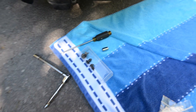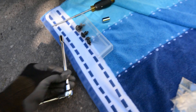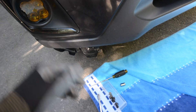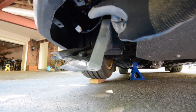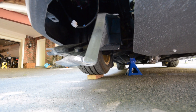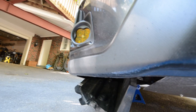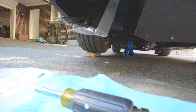Since I hadn't done this in a little while, I did forget one piece — you're going to need a 10mm socket as well to take off the bolt that attaches the splash guard just up towards the frame rail. Anyways, the splash guard has been pulled off. There's the fog light harness right there — I'm going to unplug it, and I'll probably also pop off the fog bezel up here, which will just help me get towards the screws to pop it out.